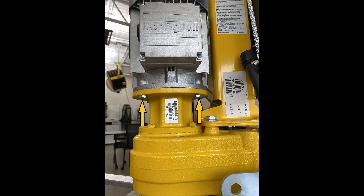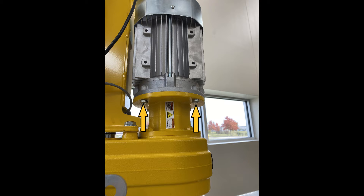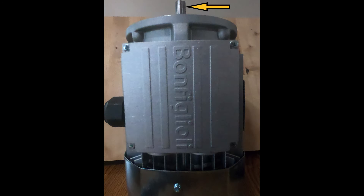The first step in diagnosing a motor failure due to noise is removing the motor. Remove the four bolts as shown in these two photos and lift the motor free of the fan. Once the motor has been removed, turn the shaft of the motor by hand to see if there is any grinding or scraping noise. If so, the motor will need to be replaced.